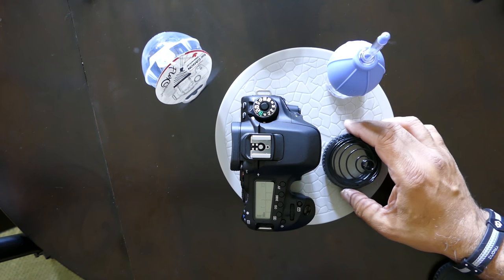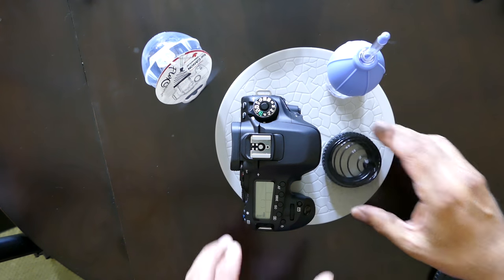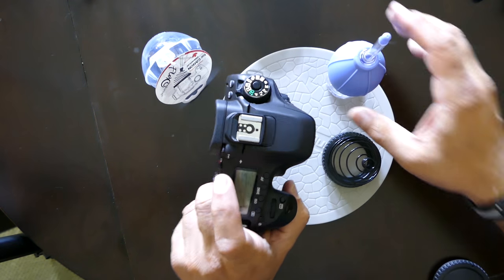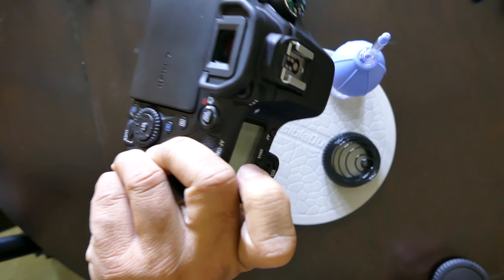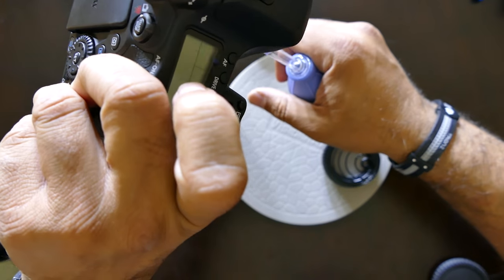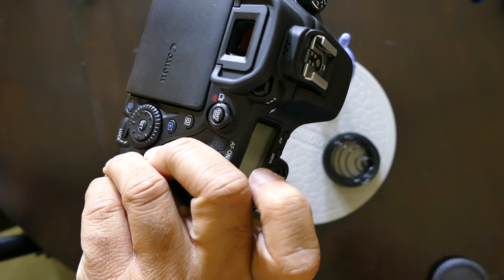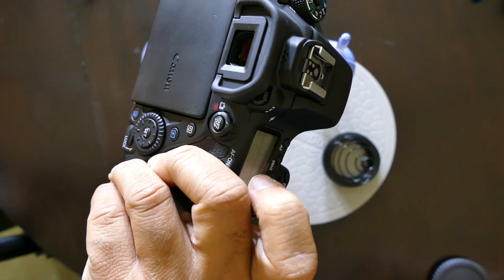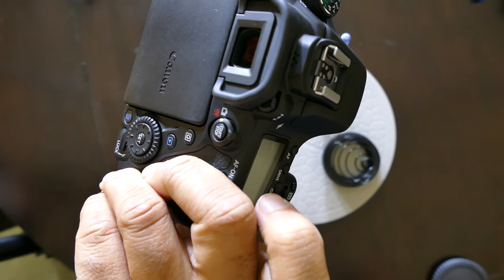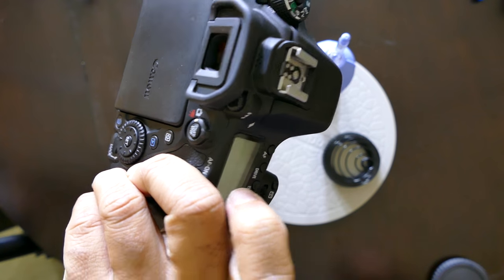So, for example, a Flexodome is a sort of device that guards the sensor from accidental stabbing by any kind of blower on the sensor. Usually, these DSLRs are heavy, and the proper way of blowing dust off the sensor is just to tilt them backward to rid of any heavy gravels, quartz, which are dangerous to sensor cleaning. So in this way, gravity has its effect, so basically you blow them off the sensor.